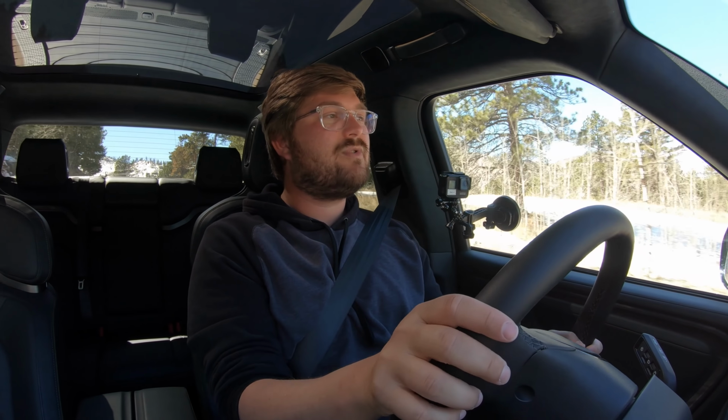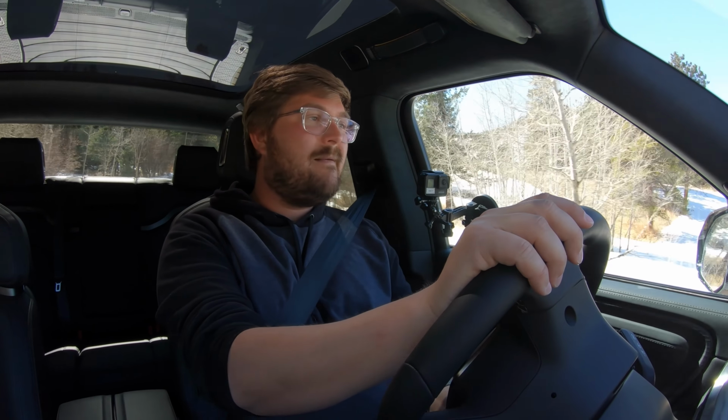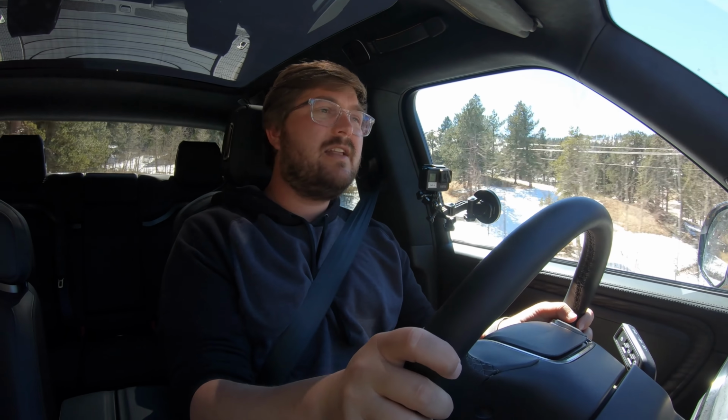It's the first vehicle I've ever driven with 4 motors, and it's very capable, but it's also a little bit awkward because of that situation that I explained back there, where you have to let the system think to virtually lock axles and to send power and to do torque vectoring. There's no mechanical locker. And one thing I really appreciate about Taycan and RS e-tron GT, that J1 platform, is coming out of a corner, it has a mechanical rear locker in the spicy ones, and if you just mat the throttle, it just goes lock, and it's totally predictable.